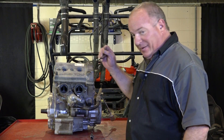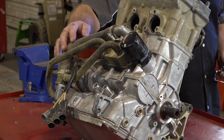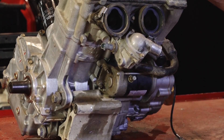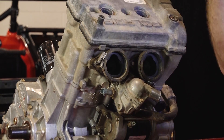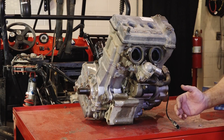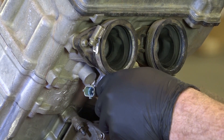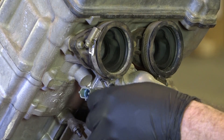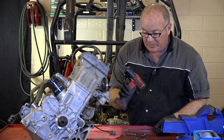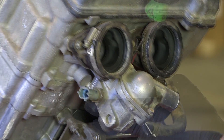Alright guys, here we are at the teardown bench. So what's the first steps? We want to go ahead and get all these hoses off, get the starter off, go ahead and get this outer cover off, and we'll bring it around to top dead center, take a look at the cam positioning to make sure it's on the compression stroke, and then we're going to start breaking it down. Let's start by getting that thermostat housing out of the way. I've said it several times, I'll say it one more — I love these things for taking things apart, but do not use them to put things together. It'll be painful if you strip something out, especially on the inside of an engine.